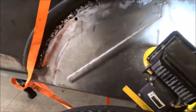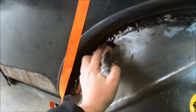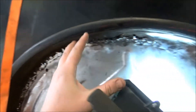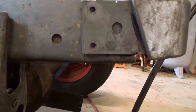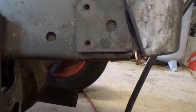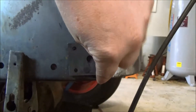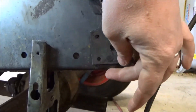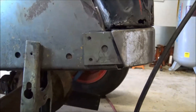And then I've got a wheel well. When he was putting it in, he had it clamped up and was cutting it and then spot welding it as he cut it. I think it was starting to warp it. Now I'm about a quarter inch low on this side. On the other side it sits fine. So I've got to figure out a way to have this sit flush — whether I have to cut this out and taper it and bang it in and weld it back in.